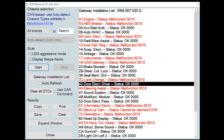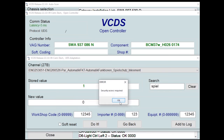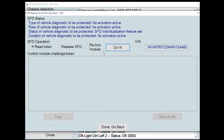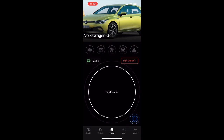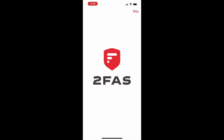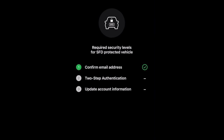Next up, we need to do our codings and our adaptations. Normally this is where I would break out VCDS and go step by step to activate all the power fold mirror functions. However, with the Mark 8, the electrics module is security protected and VCDS can't unlock it. So you have a couple of choices — you can take it to the dealer and have them do the coding and adaptation, or you can be extra crafty and probably find a way to use VCDS with some other resources to unlock it, but to be blunt it's a little sketchy and I'm not super comfortable sharing it. Luckily, there's a pretty easy solution: using OBD11. Before getting started with OBD11, you need to make sure your account information is fully up to date and you have a two-step authenticator app on your phone — you'll need both of those things to get SFD unlocked to work.